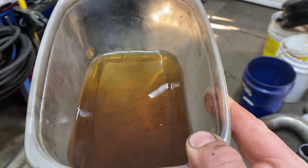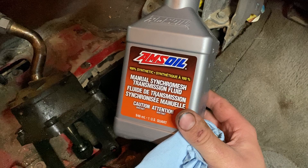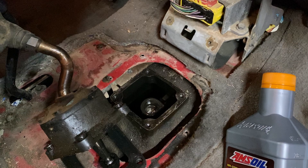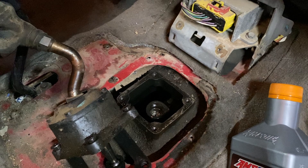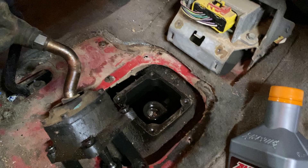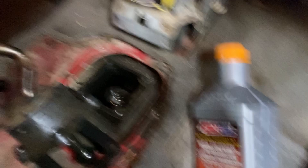Back up top, we've got the shift tower off, and our fluid of choice is AMSOIL manual synchromesh transmission fluid. Normally I run Redline MTL, but this was about two bucks cheaper and convenient, so I'm trying it this time — I've heard pretty good things about AMSOIL. For the NV5600 and Dodge transmissions, if you're a second-gen guy, you typically want to run a liter over the recommended amount, as the rear bearing has been known to get starved of oil. That's six liters for the NV5600, and five liters for the NV4500 — same deal. For the NV4500, I like to run Redline MTL if it has no brass synchros, but if it has brass synchros I run Redline MT85. Redline MTL might work for other transmissions too — I ran it in my Subaru and Volkswagen trans and it worked good.